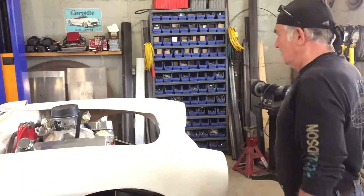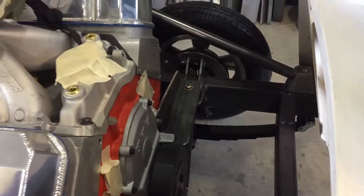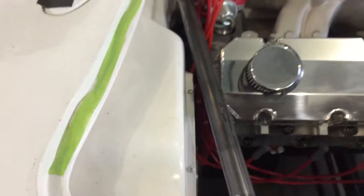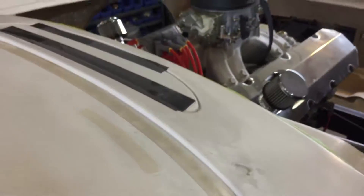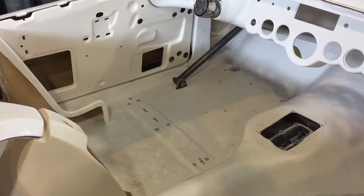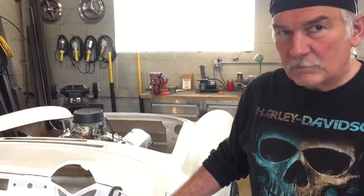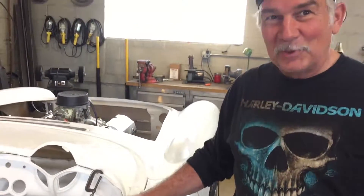That's the reason for the extra superstructure — the car would never handle that kind of power originally. You can see some of the truss system here; it eliminates all the flex and torque loads that would otherwise be in just two frame rails that would twist and move. The body is really just along for the ride — I wanted all the structure in the frame. Those trusses that go inside the car are removable; they go through the floor to the end of the ladder bar mount. That's what I call the superstructure — the rest of the frame really goes along for the ride.